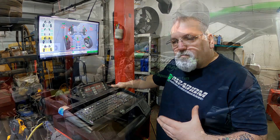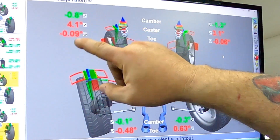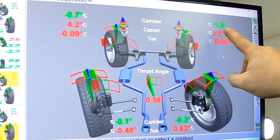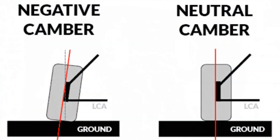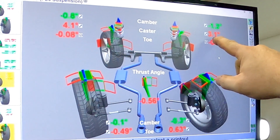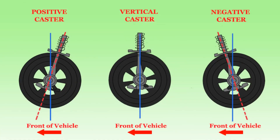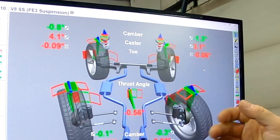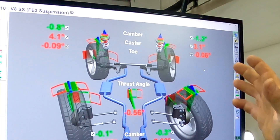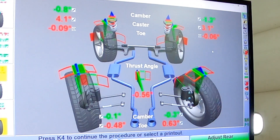I've rolled the car forward, got the head put on it, and made all the measurements. This shows your camber, caster, and toe on the driver's side — we've got negative 0.8 degrees of camber, but we've got more on the passenger side, so we're going to try to get rid of a little bit of that. Camber is how your tires are sitting either out or in at the top. We're also a little low on caster on the right front, and we'll set toe as close to zero as possible. The rear end is pointing left, which we'll address with suspension changes.